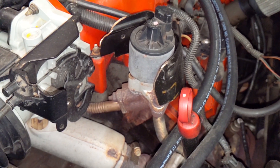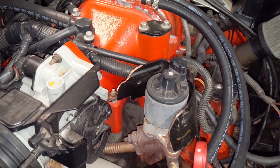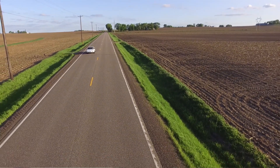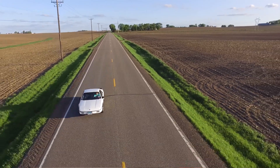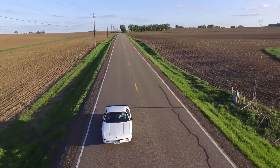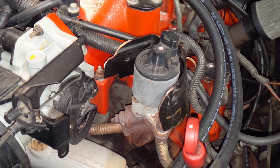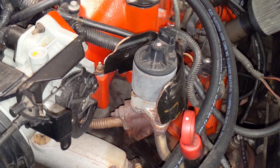What it does is inject inert exhaust gas back into the intake system at cruise. The way I look at it, it's kind of like displacement on demand. This is a 3.8 V6, and when you're just cruising in a lightweight car like this, it doesn't need much horsepower. But it does need to stay burning at 14.7 to 1 — that's what they're programmed to burn at on lean cruise. By injecting that inert gas into the cylinder, it makes the cylinder smaller essentially, and the rest needs to be 14.7 to 1, resulting in more fuel economy.